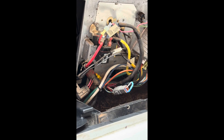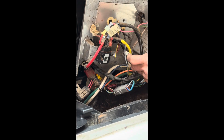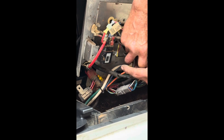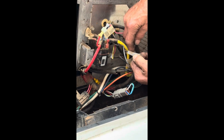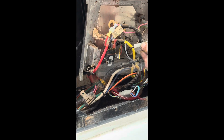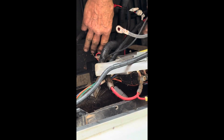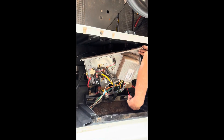The next step is to remove the charger receptacle wiring from the back of the onboard computer — nothing more than unplugging the small gray wire and the 10-gauge black wire from the back of the OBC. There's a little tab on the white plastic connector that you lift up on to pull the black wire out. It can get stuck; sometimes it's pretty stubborn. Don't worry about breaking it because you're not going to use it anymore. Pull the small gray wire off the back of the receptacle after you get the black wire loose, then fish the entire wire harness out of the back of the battery bucket all the way up to the back of the charger receptacle and remove it entirely.